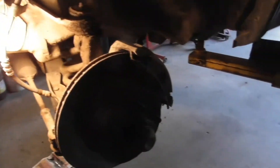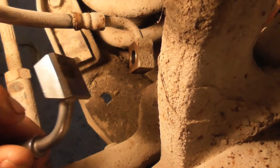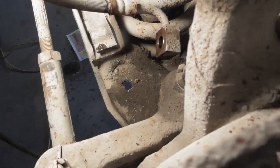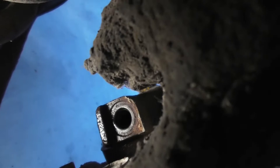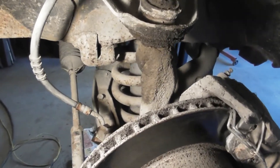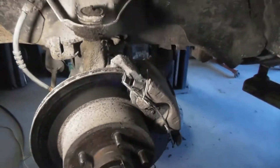I'm working on the driver's side now. Put the new hose on and ran into a problem. You can see that bevel there — I had to grind that bevel in because it came square on both sides. Without that bevel, the hose wouldn't fit back in there right, wouldn't fit in the caliper. So I had to grind on it. The joys of working with aftermarket stuff — nothing usually fits right, you gotta make it.